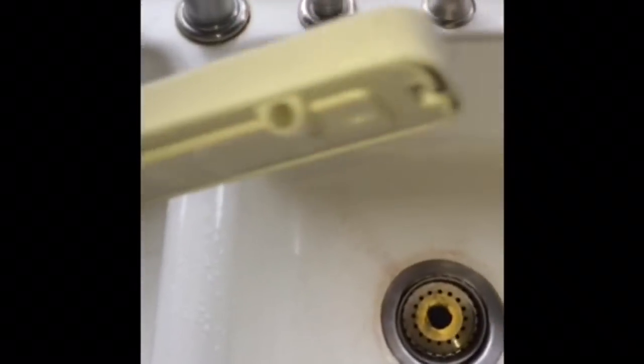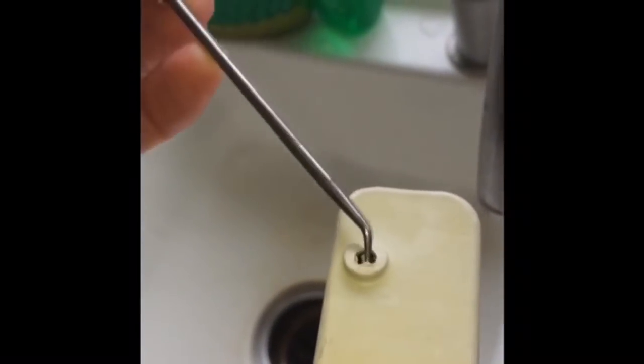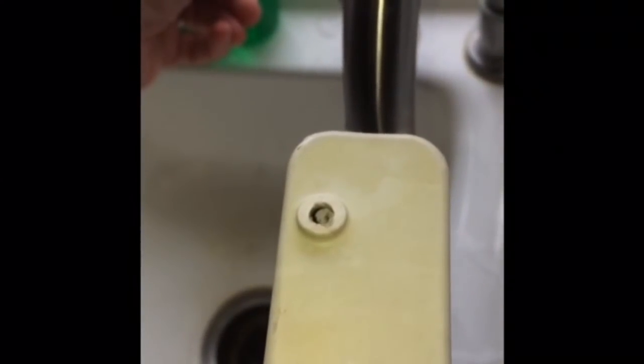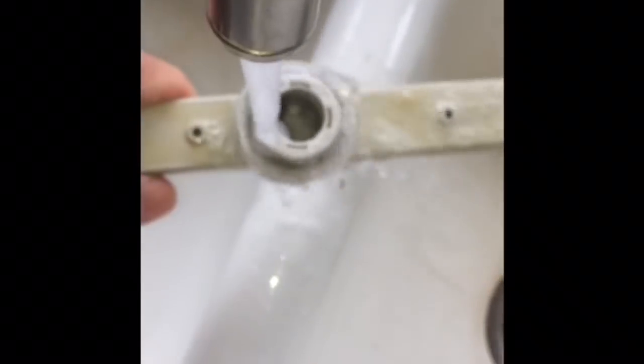This is the upper spray arm. If you have a little clog in a jet like we see right here, it prevents water from hitting the glasses in the upper rack. You can use something sharp — maybe a dental pick or an extended paper clip — and push the object back in or try to fish it out. If you push it back inside, use a stream of water going in and out of the spray arm, turn it upside down, and it should fall out. Repeat that a couple of times until it's clear.